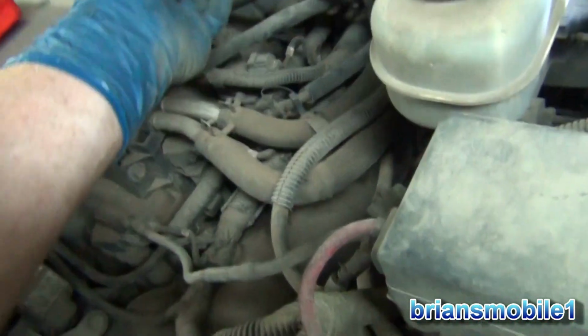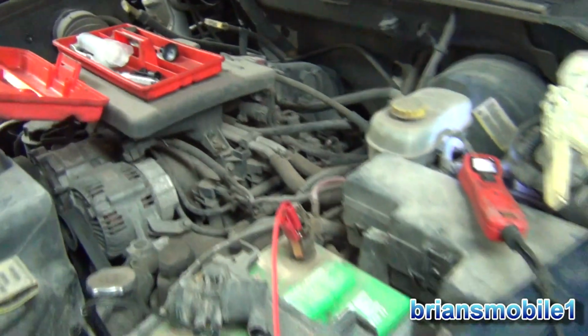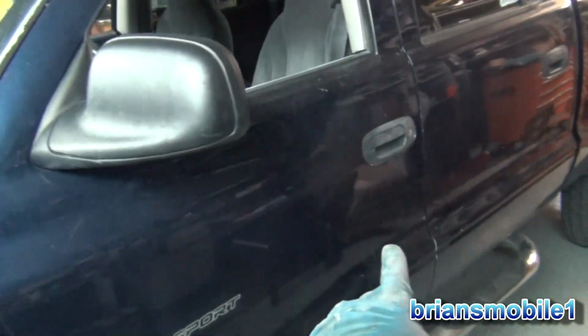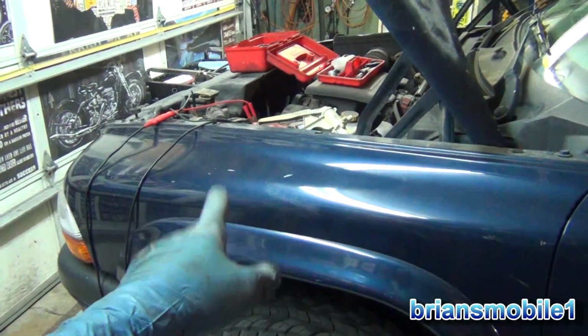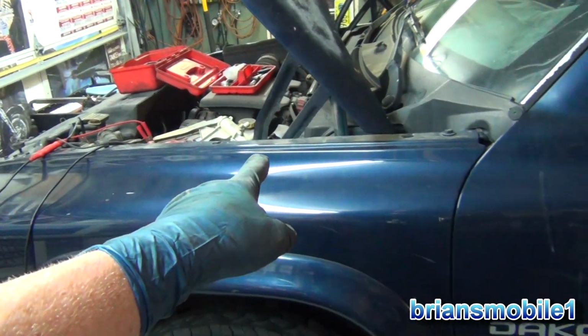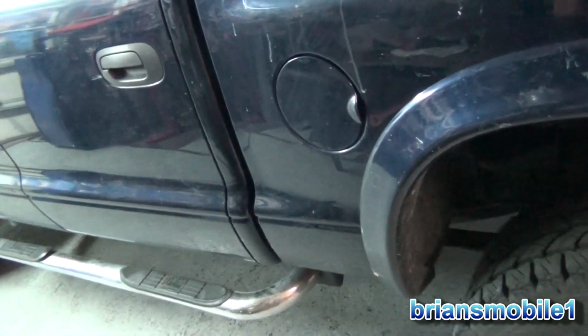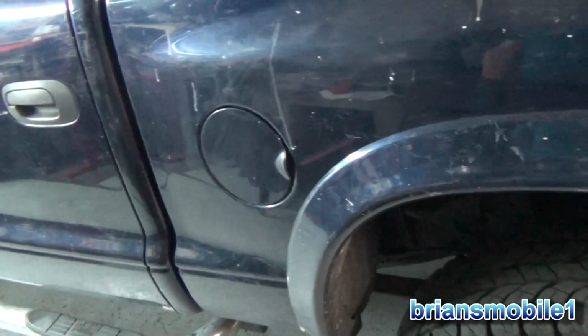So you've got this line that goes to the throttle body right here. And the way that the system works, now that you know that we go from tank to charcoal canister to purge solenoid to the intake, basically we've got a direct line, indirectly, to the intake where it sucks it up. So basically what the charcoal canister does, charcoal has a unique ability to absorb hydrocarbons, which makes sense because carbon that's been depleted or burned has the ability to hold additional hydrocarbons.